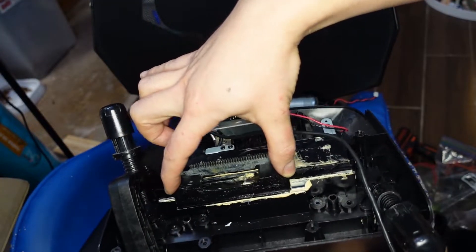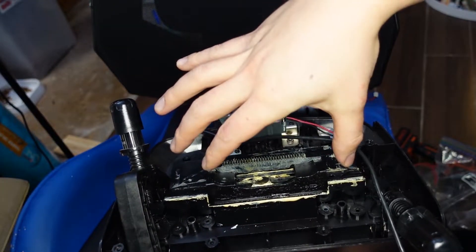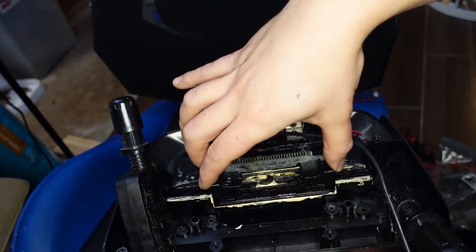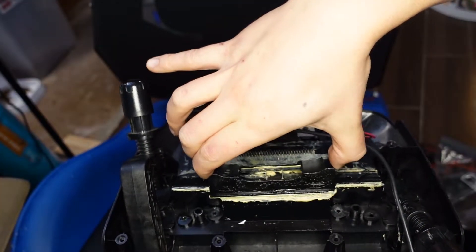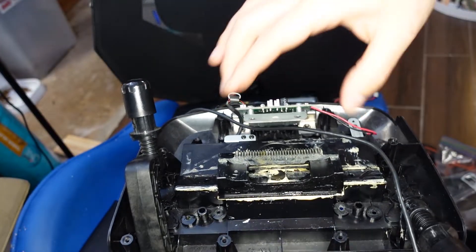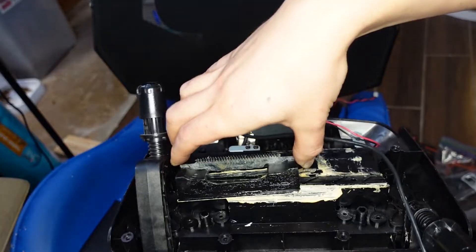Generally, if you tighten those up, this whole thing will go down and that'll work better. The problem is this is your lock mechanism — this is what's physically sliding back and forth, and sometimes it'll get a little bit off kilter. If you do disassemble it and put stuff back together, it's important to note that there is a spring right here that keeps tension on this whole piece, so make sure that goes back on appropriately. That's what causes the clunk at full lock.